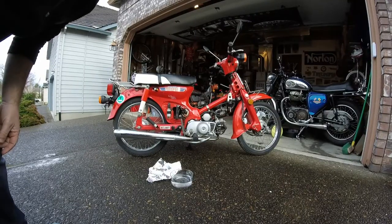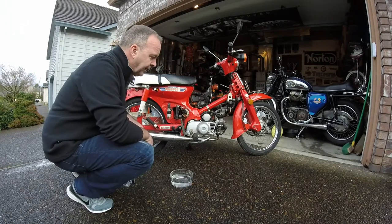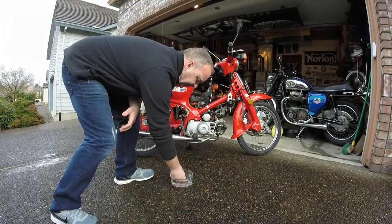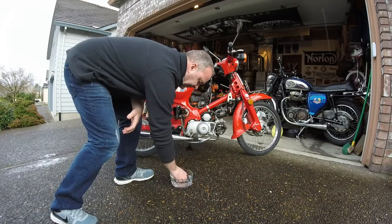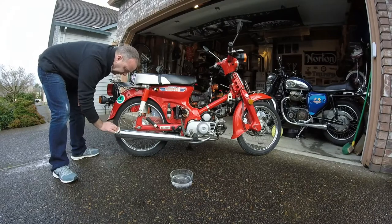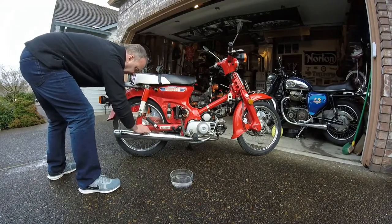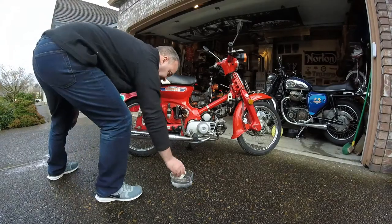This is one of my little tips and tricks for cleaning alloy and chrome — rims in particular and silencers like this. Just take a piece of aluminum foil, scrunch it up, then dip it in water and get it very wet. You wouldn't think that this would work but it actually does work really well. Then ever so gently rub it like a cloth over the chrome work, getting into the nooks and crannies. Just be careful you don't scratch it — super light, keep it really wet. It works well not only removing the rust but laying down a deposit onto the chrome work.